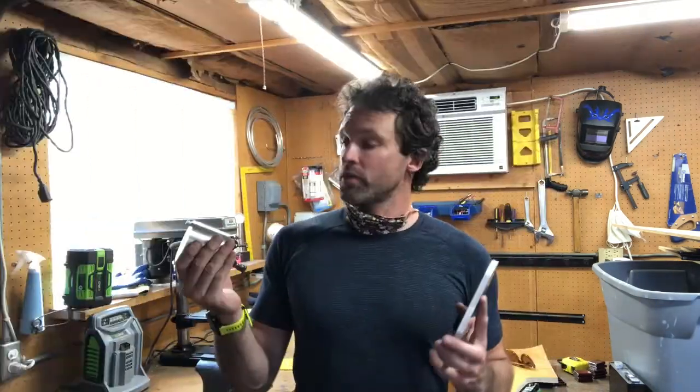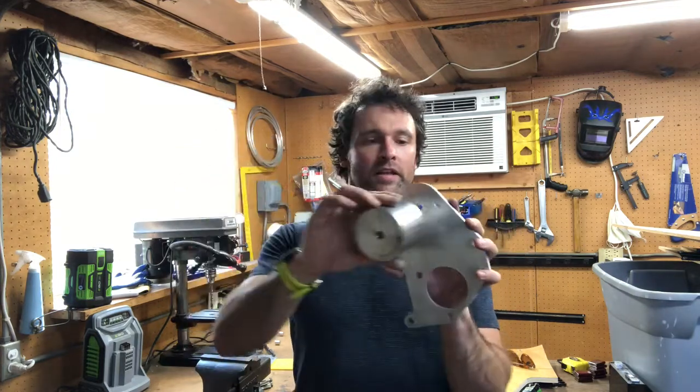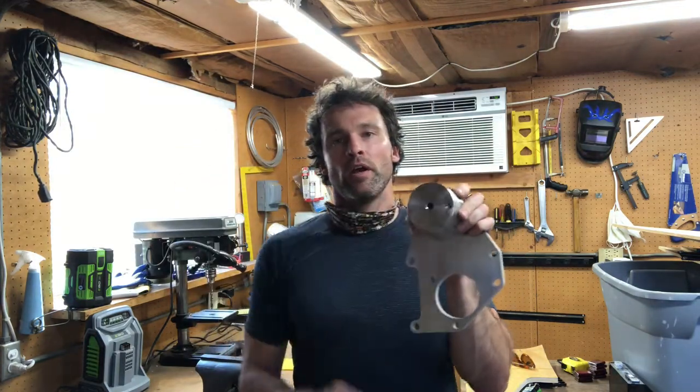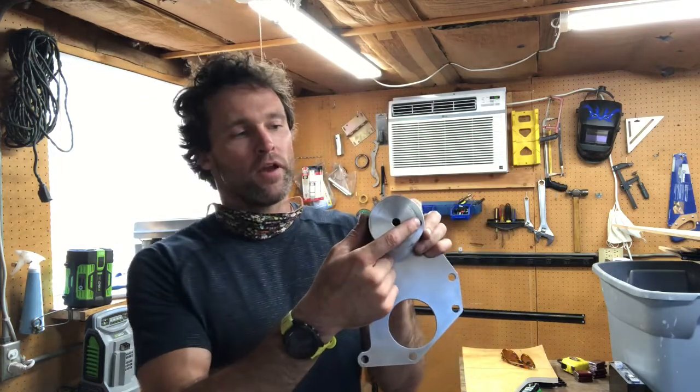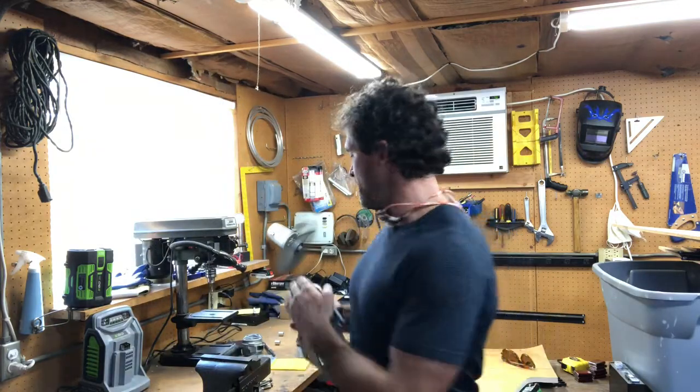Let me show you that. This spacer mounts onto the AC bracket right towards the top. There's a hole here for this pin to slide into, and then a hole there which the tensioner slides into, and then that's all bolted together. This is then boxed in with the rear — these basically sandwich a spacer, which helps give this strength by boxing the two together.